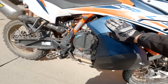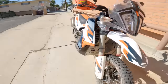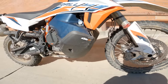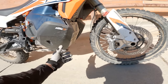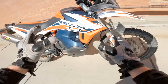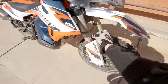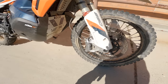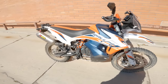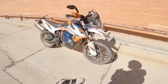The other big notable thing is the gas tank — it's sort of a horseshoe shape. It comes down on either side and these lobes carry most of the fuel, which means all the weight ends up down low when the tank is full. There are a couple of drawbacks with the fuel gauge, but in general it's a nifty design — a little strange looking but pretty smart. The WP cone valve suspension is the bee's knees in the adventure world, at least from KTM, with 10.6 inches of travel front and rear.